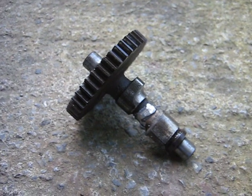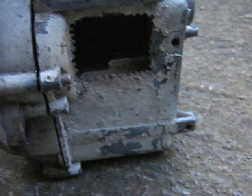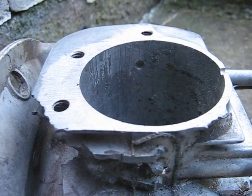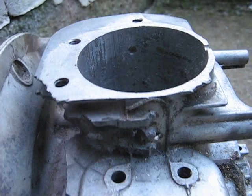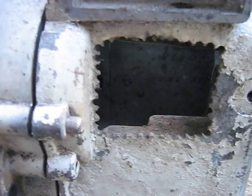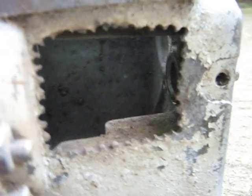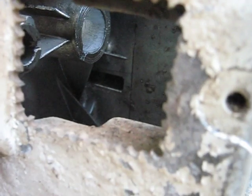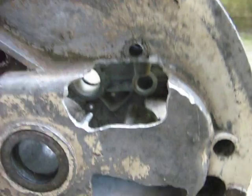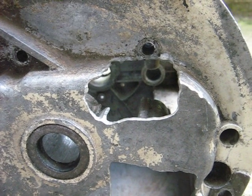The way I make these camshafts easier when I split them like this is I have this jig. It's just a block that I used in the sleeve valve development that I've cut various places, and I just cut a hole right beside where the camshaft goes. That way I can get in there and weld. It's also got access holes in the back to rotate the camshaft.